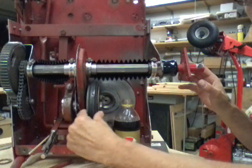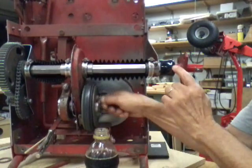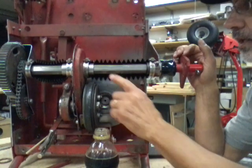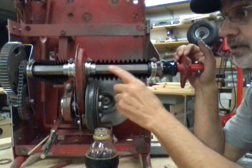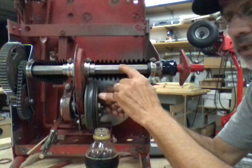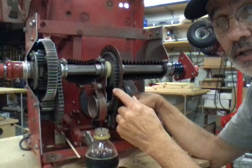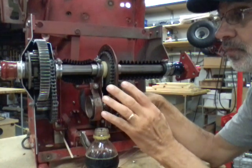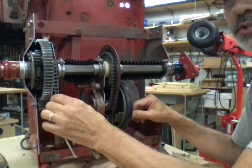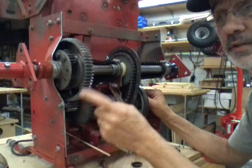If you had tires on, your tires will turn — you can see the wheel flange turning right here. If it's not turning, the first thing you want to do is disconnect one of your boots, slide it back so you can see your hex shaft, then turn your clutch again. If your shaft is turning, then your chain case is okay — there's nothing in there but two sprockets and a chain. So now that means the problem is further down the drivetrain.